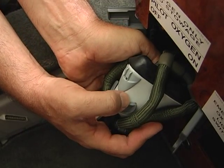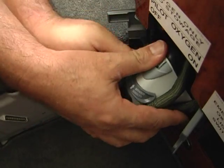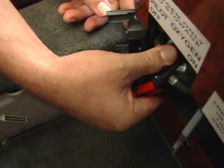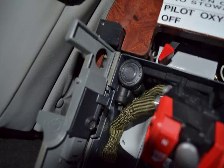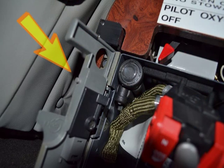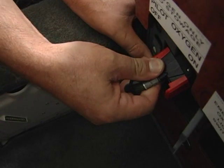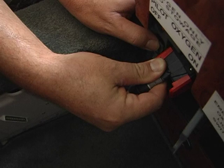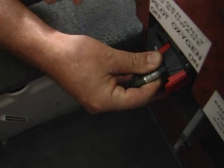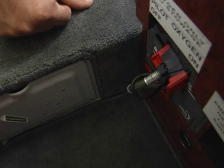With the hose already in and the mask ready to go in, it is installed on an angle — neatly put up and in, then worked toward the back. The goal is to align a pin into the small hole on the side of the oxygen mask red tab. The pilot must angle it correctly and press the test and reset button to reset the oxygen on flag; otherwise the pin will never align. After pressing test in and hearing the click, the pin lines up with the hole, and then the right-hand door is closed and the mask is properly stowed.